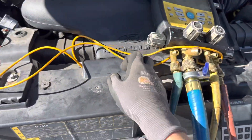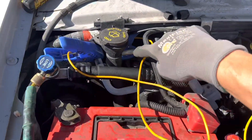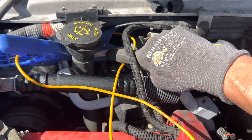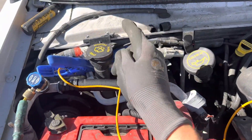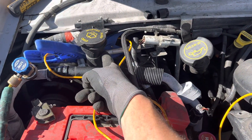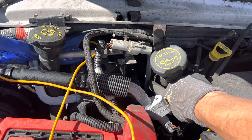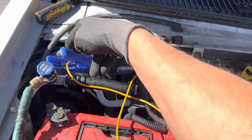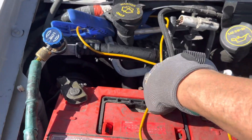I do not have the liquid clamp on the liquid line — I have it on one of the suction lines. There are two suction lines here. One goes to the evaporator through an orifice tube. You can see this dimple right here — this is where the orifice tube is located behind this nut. I'm taking the temperature of the refrigerant just after the orifice tube in a semi-liquid state. This line right here is hot — semi-gaseous liquid state — entering the orifice tube and then coming out cold on the other side.